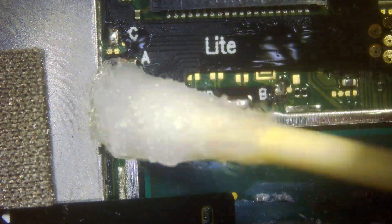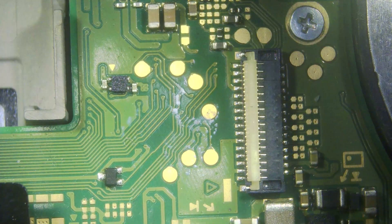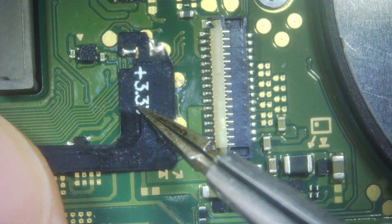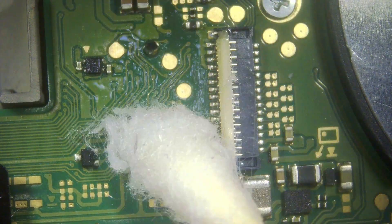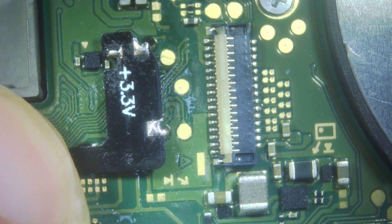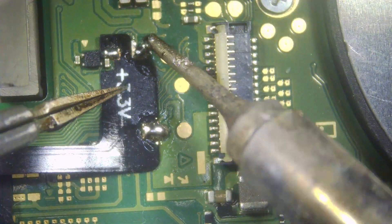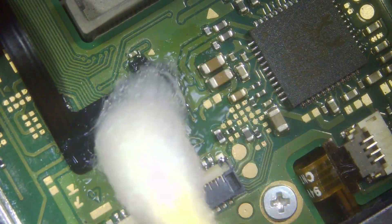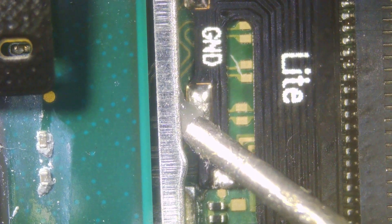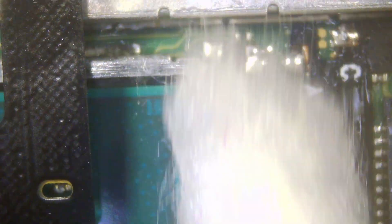So they seem good — just give them a clean with isopropyl. Then this game card needs to come out. We just need to fold over the ribbon cable, and then we've got three points that we need to solder to — there's a cap on the top and then these two pads. Flux again, come in with some solder, give it another clean. Then we'll fold over the ribbon cable and do the big pads first — position it, make sure it's all lined up. Then we'll do the top one with a little bit of flux, and then a little bit of flux on this cap here, and then we just need to solder that. The final bit we will do is a ground pad. The ground pad on the ribbon cable does need connecting — I'm going to do both, as we're doing a thorough job. Keep cleaning as we go along to get rid of all the old flux.